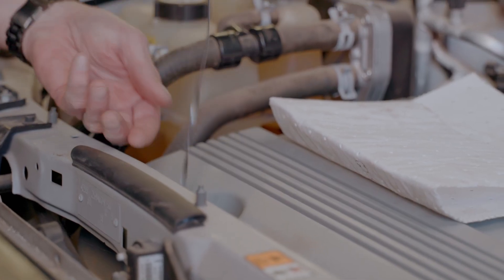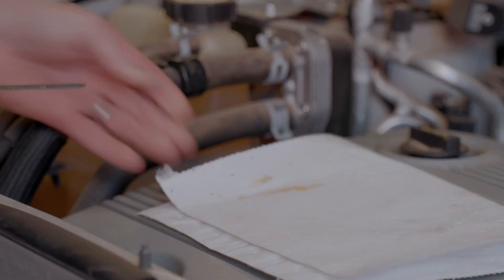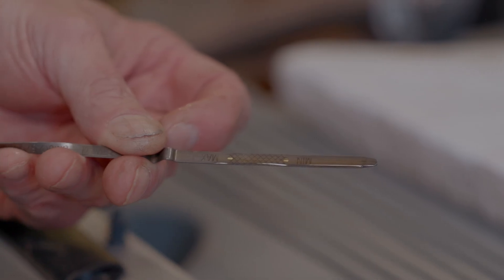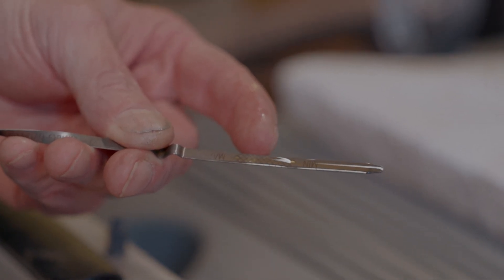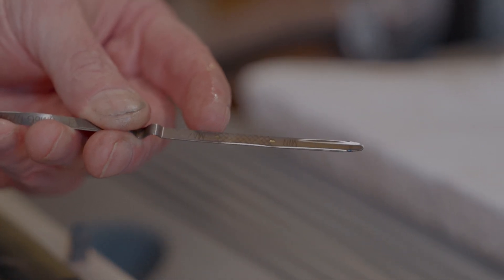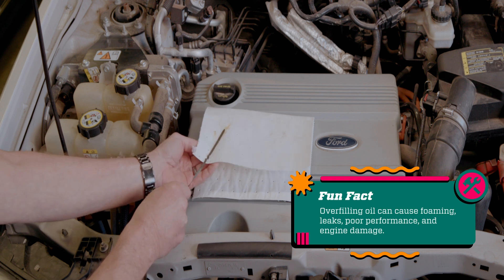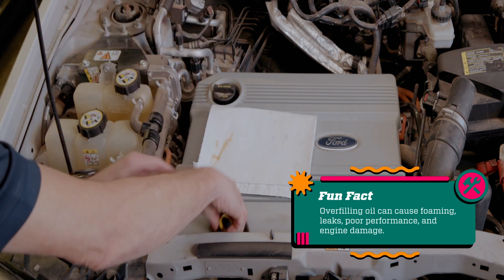The first thing I want to do is remove my dipstick from the holder, go ahead and wipe it off on a clean rag, and then reinsert it into the holder. When I pull it out again, I'm looking for the two dots on this dipstick — does the fluid level fall in between those two circles? If it's below the bottom circle, I want to add a little bit of oil at a time, no more than one pint. Overfilling an engine with oil is actually worse than running an engine out of oil. Once I've verified the level, I'll wipe it again and return it to its holder.